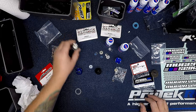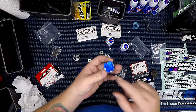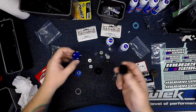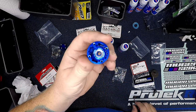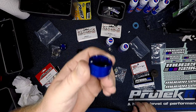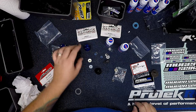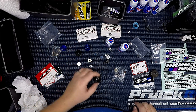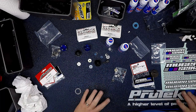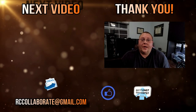That's my bit on differentials. I'm not actually going to build one right now, but I wanted to warn you about the aluminum cups — it would certainly suck to buy these expensive things, run them, and end up with a trashed cup. You have to use the big shims to protect your aluminum cup, and I would do it to protect your o-ring even on the factory stuff.